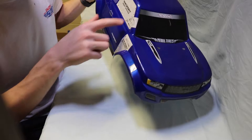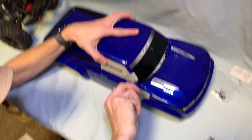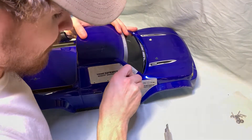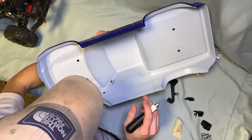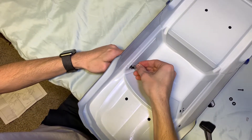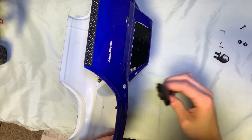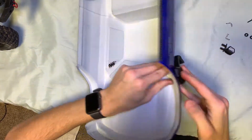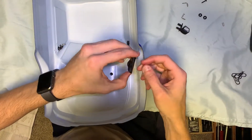Now what we're gonna do is put some holes in here, slice this little box out, and do the same on this side. Then we'll install the other stuff — a little rubber washer on, then take one of your pins and push it through. On the other side, it looks like the snorkel slides in and then the mirror will actually hold it in. I'm gonna flip it through this little hole that we cut, slide it down, put it in, and then install the backer piece for it.